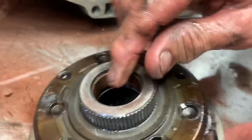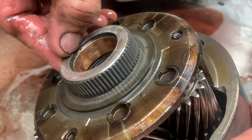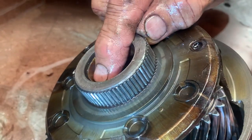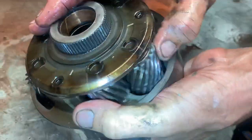This bushing — anytime you put this bushing in, you better stake it down. A lot of people try to push it flush, but the bearing that sits in here has a shank on it that sets down into this. If you put that bushing in flush it's going to break that bearing when you bolt the pump down, and you won't even know you've done it.